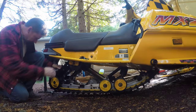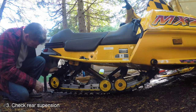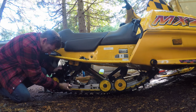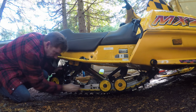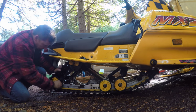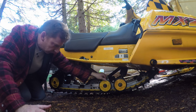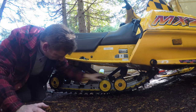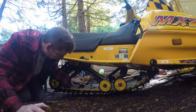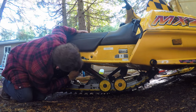Let's start at the back. I'm going to give the track a good inspection for missing lugs and tears — my track is actually in pretty good shape. I'm going to check the sliders as well and make sure they're okay. I've got the back of the sled lifted off the ground so there's less pressure on the idler wheels or bogey wheels, and I can check to make sure the bearings are good on these. Make sure the rubbers are all there and have a general look over the suspension parts.